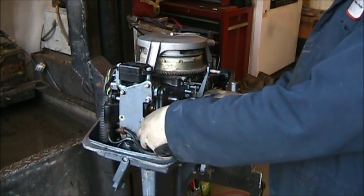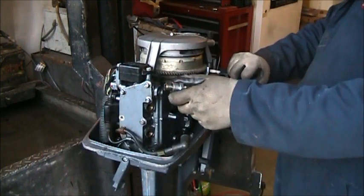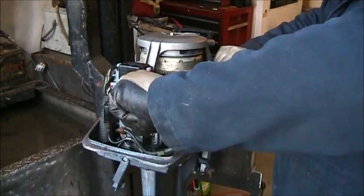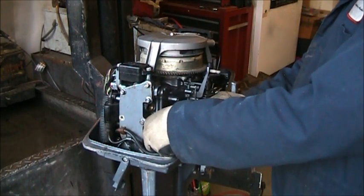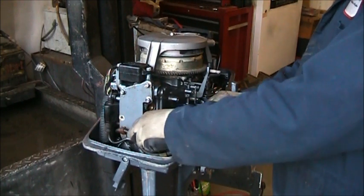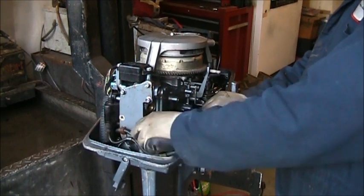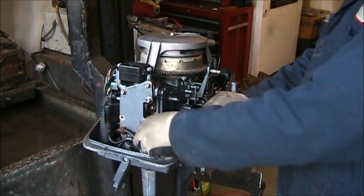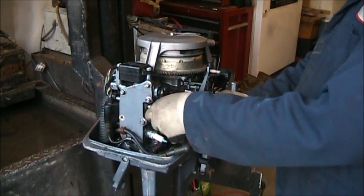So if you hear a big boom when you do that, you got that piston all stretched out coming on the downstroke, and you put your screwdriver in there and you feel some play and a little thump, you could have some conrod problems. But this one feels good and tight, so I'm guessing somebody was in here messing with the plug.